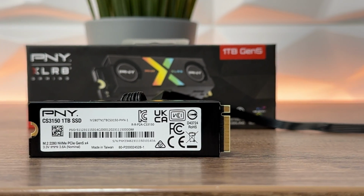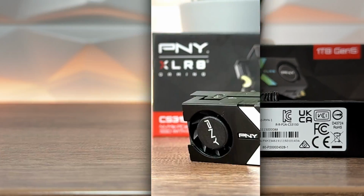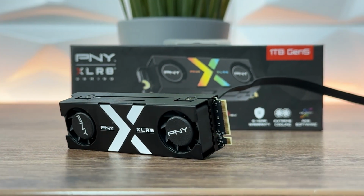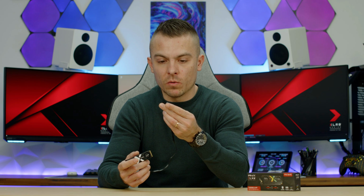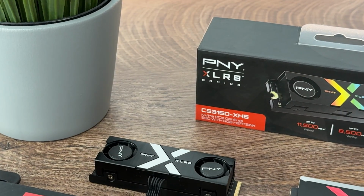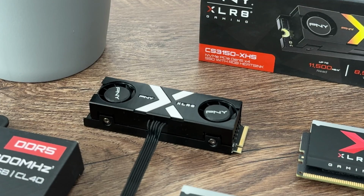This is really good. And I really like the possibility to be able to adjust the fans, because you have a connection right here that isn't your regular connection. So it's not 4-pin PWM, it's not anything similar to that. It's actually a 9-pin for the USB 2.0, but it isn't full 9-pin, right? It has a 6-pin connection. You connect this to your motherboard's internal USB 2.0, and you get the possibility to adjust everything through Velocity X.